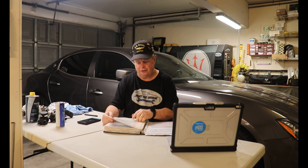The first issue I had with the car was the headlamp bulbs. One of them started to turn dark yellow and was uneven. You have to remove the front bumper and pull the headlight assembly off to change the headlights. This happened June 28, 2018, at 60,908 miles. I got Osram Xenarc D3S bulbs on Amazon for a total cost of $74.95.